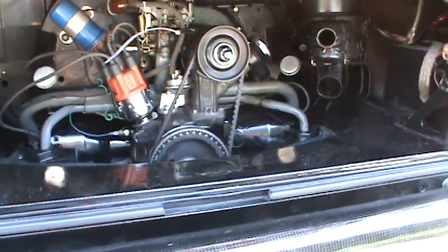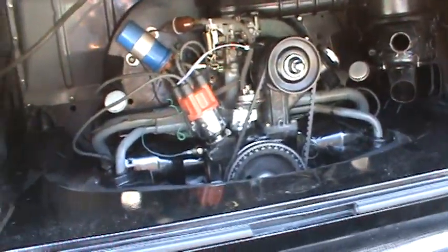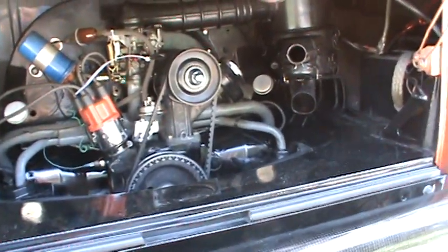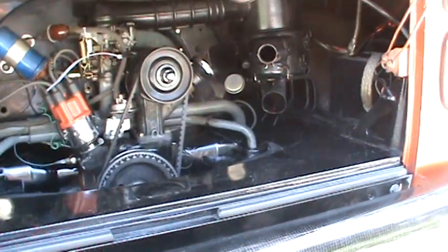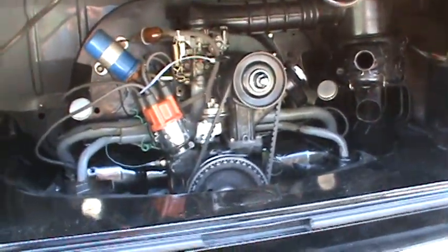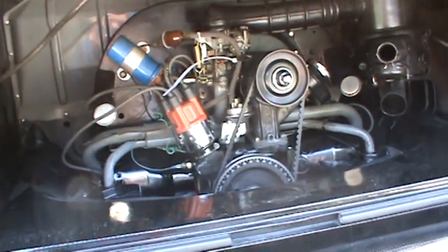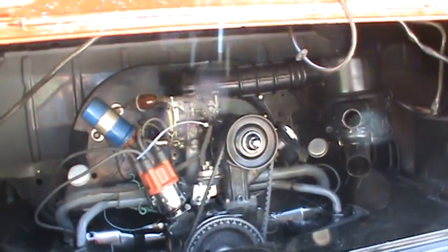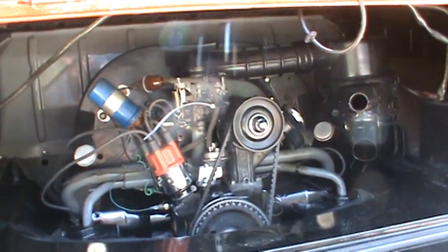I'm gonna put the 2110 in here with some 48 Webers and buy a set of cylinder heads, scrape some money up, and try to get some new heads and some that are machined out for 92s, so I can put that aluminum case motor in here and see if I can get some satisfaction, because I'm driving myself crazy with this. It shouldn't leak, it should be fine.